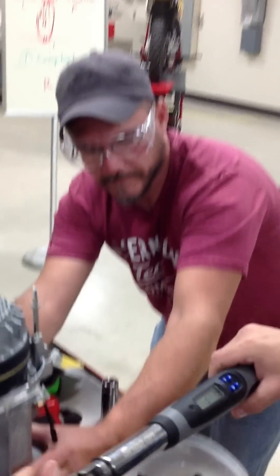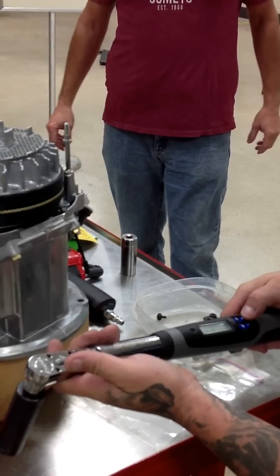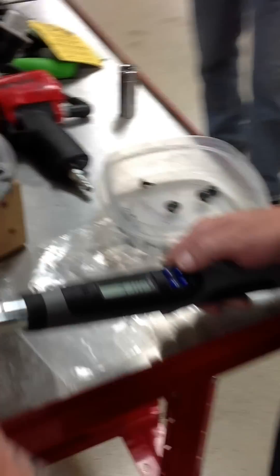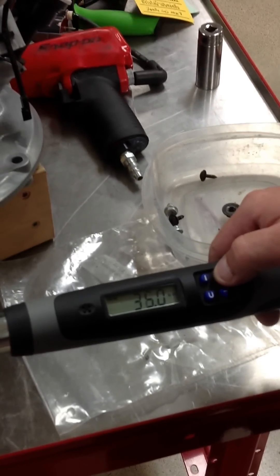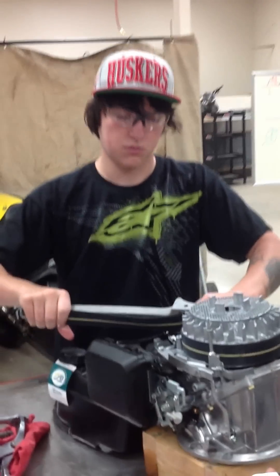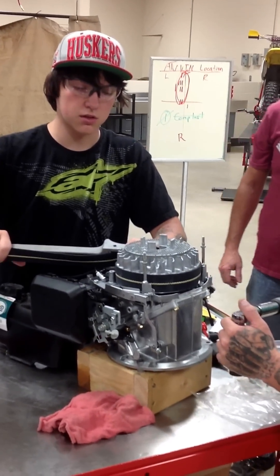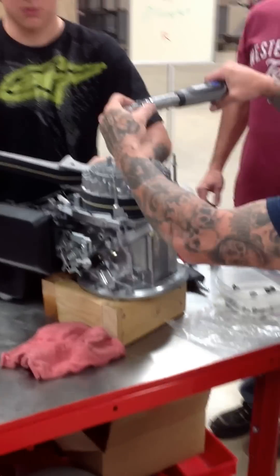Hopefully you can hear the buzzer on there. What Alan's actually getting is a vibration sensation through the wrench as well, stating that he's got that done correctly. He's going to hit the up buttons here and pop it up now to 55 foot-pounds. Did it feel like that flywheel was slipping on you there, Cyrus? If we get to the point where it continues to slip, then we just re-tighten the strap wrench by pulling the angle back, pulling a little more strap through, and then re-folding it over.